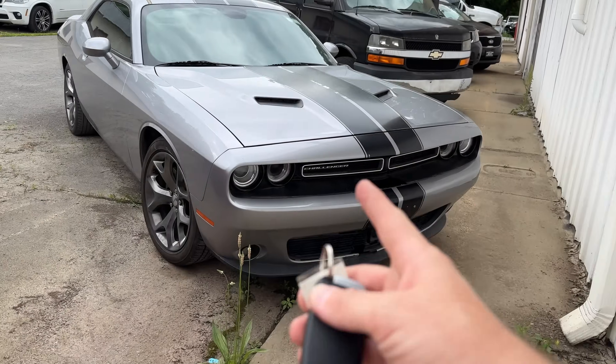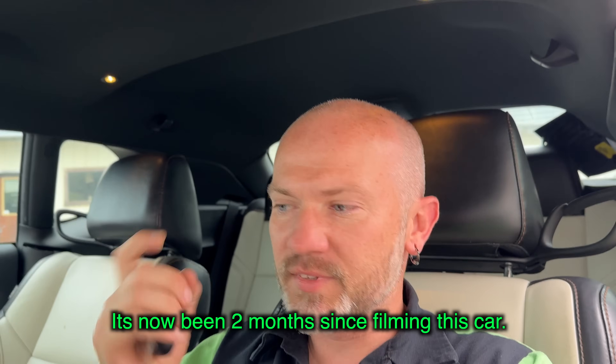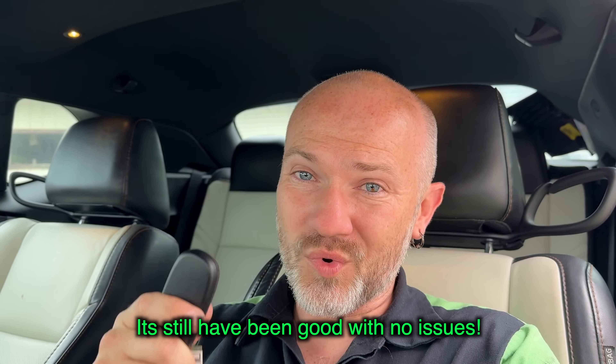It's been a couple of days. I put an RF hub in this thing and I've been letting it sit outside, cranking it every day. It's been probably three days now without being touched and it started right up. I got a brand new RF hub from the Dodge dealer, put it in, had it programmed to the car, and it has not died once since then. So I'm calling this a fix, and hopefully it doesn't come back and bite me later. If it does and this car comes back with a battery drain, we'll film it. Thanks for watching everybody — see you guys later.